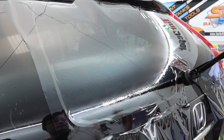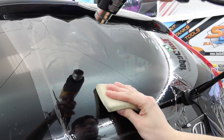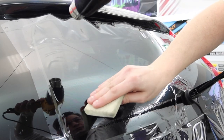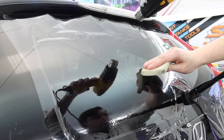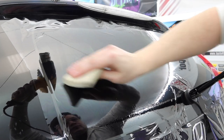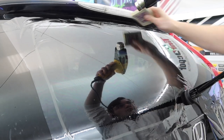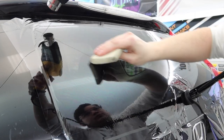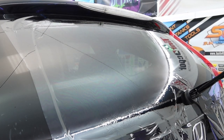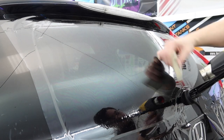Get real close to that bottom edge and finish it up. Moving back to the top — it'll just go much faster because of how light that top is in comparison to the bottom edge. It's just not near as curved, so this will all move pretty quick. Wait for the film to go sideways, press it down with the felt card. Get a little closer with the heat gun as you get closer to the top, just because you've got more material to shrink together, and boom — you're all set. Except this lower center corner — got to get that. There we go.